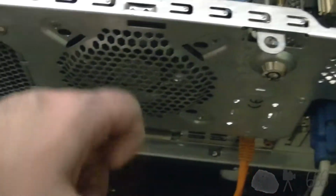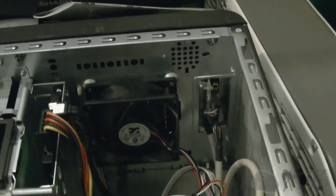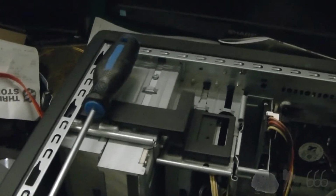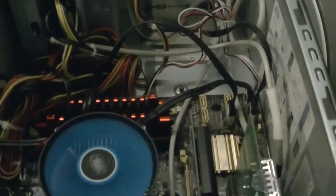Okay, I've moved everything over that I'm going to move over, which actually turned out to be quite a fair bit. So the 2 expansion cards are there, using the video card. I moved the 92mm rear fan over. I think that's actually an 80, not a 92, but that fan in the front is now over here. I moved the card reader over, and I moved the second optical drive because that other machine is going to get used for something where it does not need an optical drive. So I needed the blanking plates, so I just put 2 optical drives in the system. Why not, right? So now I can put the cover on and give this thing a test to see if it actually works. Okay. Let's see what it happens to do here.